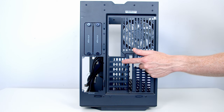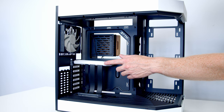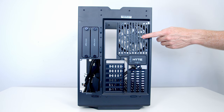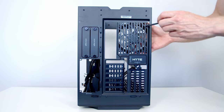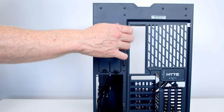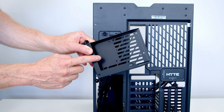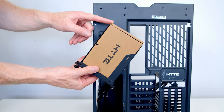Before fitting the motherboard we need to free up the riser cable by removing the top horizontal screw and sliding it down out of the way. I'm also removing the rear fan to replace it with a Lian Li Unifan for RGB consistency — it's held on with four screws. In the rear compartment there are two drive trays, each held with two thumbscrews. Each tray fits one 3.5-inch drive or two 2.5-inch drives. The second drive tray contains the case accessory box.